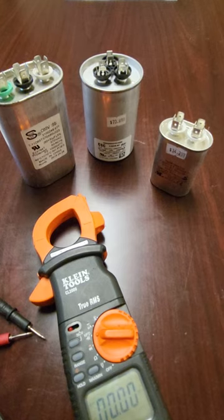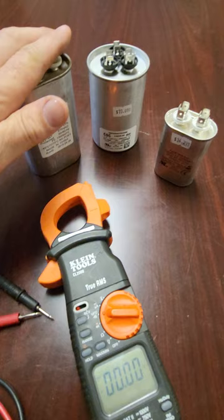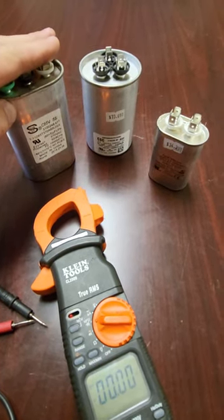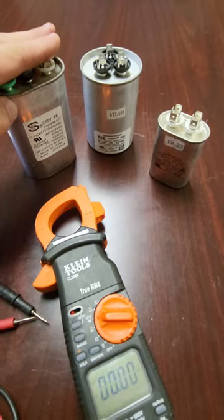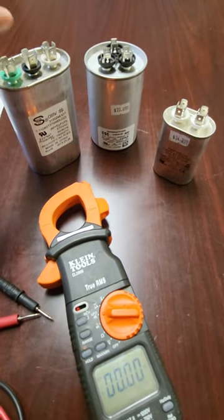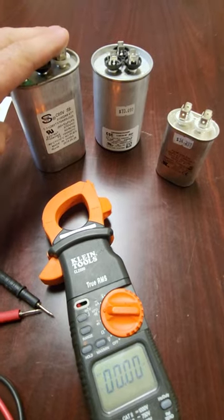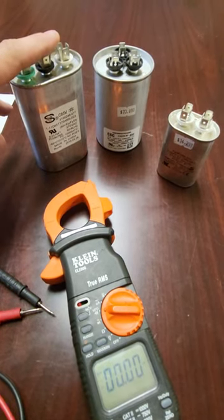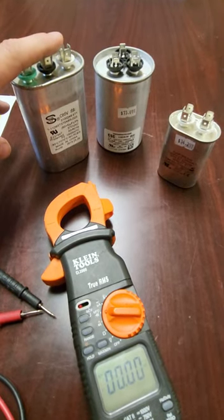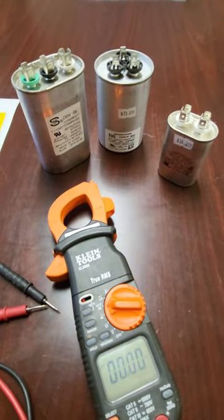It is tested the same way as these are, but for now we're going to leave it at that. These are located in your upper unit. Remember to work safely — always disconnect your shore power and turn your generator off. Make sure your inverter is off prior to touching any of these posts or wires. Lastly, contrary to popular belief, these capacitors no longer hold a charge in them, so you do not have to discharge them and short them out. After the power has been disconnected and you remove the wires, they will discharge themselves and then you can go ahead and touch them safely and proceed with the testing.